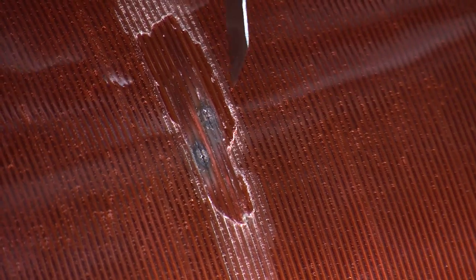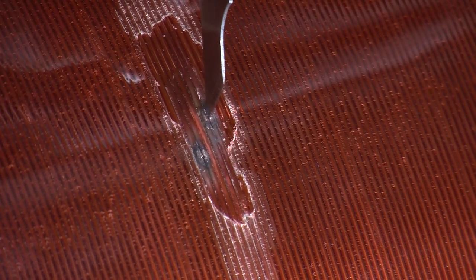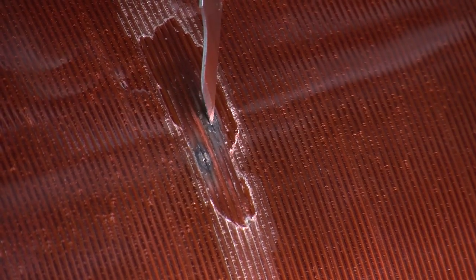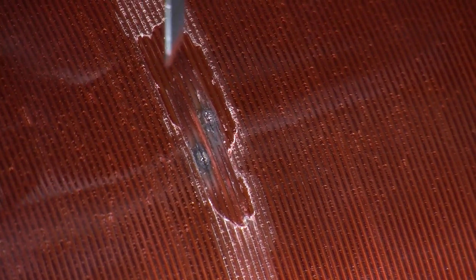If you've got a million volts across the Tesla coil and there's a thousand turns of wire, that means from one winding to the next is a thousand volts — so that jumped an arc, and it burned, and we kind of had some smoke coming out of here.